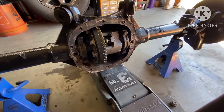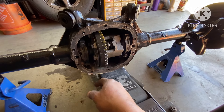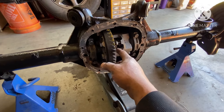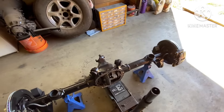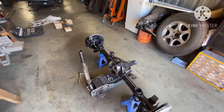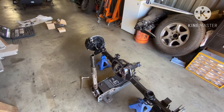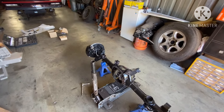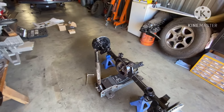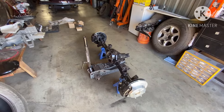These are new gears — this is a new 3.73 ring and pinion. Now like I told y'all, if you go to the junkyard these Camaros come with 3.23 and 3.42 gears. If you look at those gears and they're not worn, you can use them — there's no problem with using something used. It all depends on what you're trying to do with the car. If you're building a full-out race car, buy it all new — but new stuff is gonna break too.